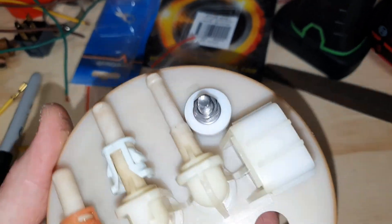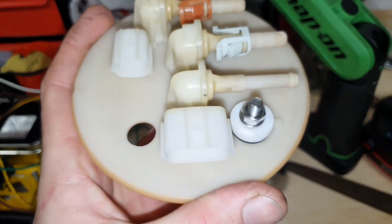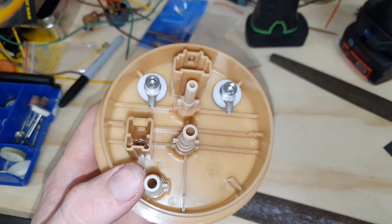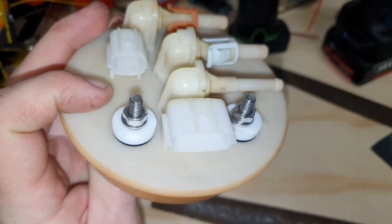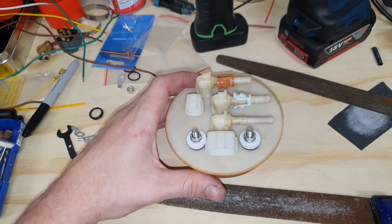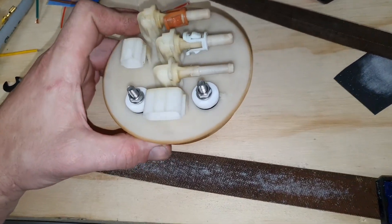That's what it'll look like, and I'll do the same to the other side. Once it's fitted, it's just a matter of hooking up the ring terminals with the wire from the relay. The electrical bulkhead connections are now fitted to the fuel top hat. The ring terminals with the new wire will go on top - one negative, one positive - connected to the relay, using the factory fuel pump signal wire as the trigger for the new wiring setup.